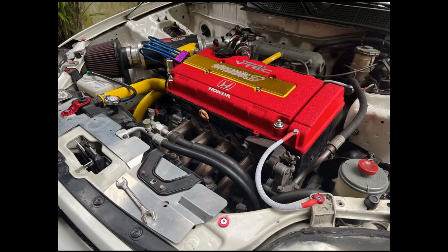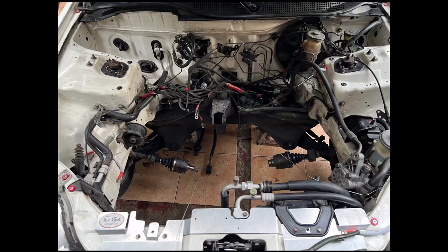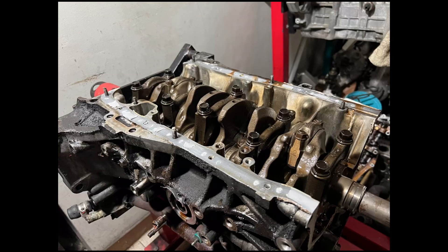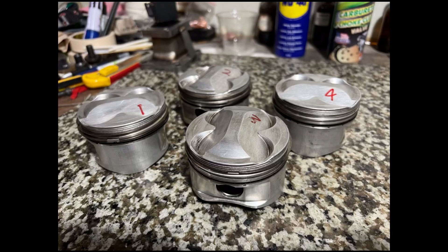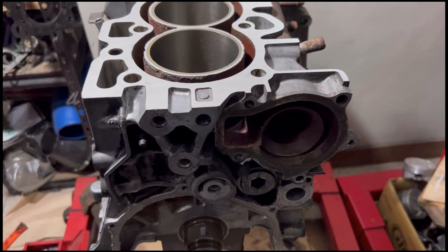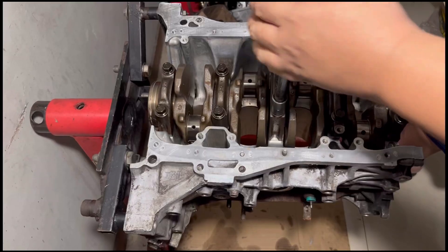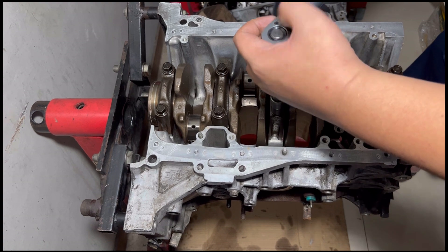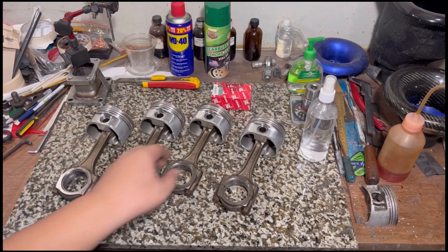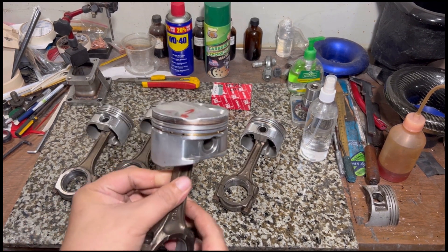On the previous episode we introduced the car, the project, the plans, then removed the engine and disassembled it. We started inspecting everything including the pistons that are going to be used. We checked the block — it's quite okay — and now here it is bored and honed to 81.5 millimeter bore. We assembled the crank and will show you all the things we did to this block, plus share some tips and tricks to gain as much power as we can.